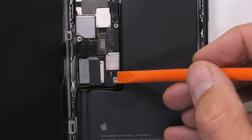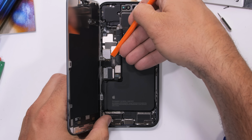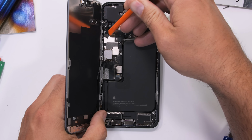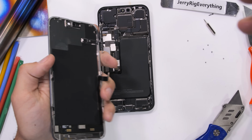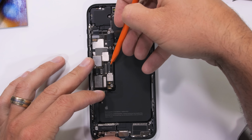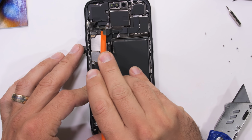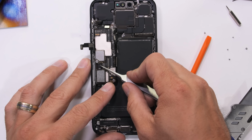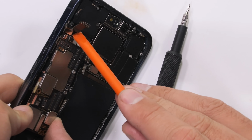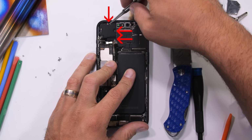The battery plug has a convenient positive and negative icon on the Lego-style ribbon connector, and then we can pop off the 2 screen ribbons. Not too shabby. With the very thin screen taken off and set to the side, we can use a plastic pry tool to pop off 11 more Lego-style ribbon connectors from the motherboard. There are 3 standoff screws and a 4th tucked way up under the loudspeaker in the left corner, which is held in place by a few screws of its own.